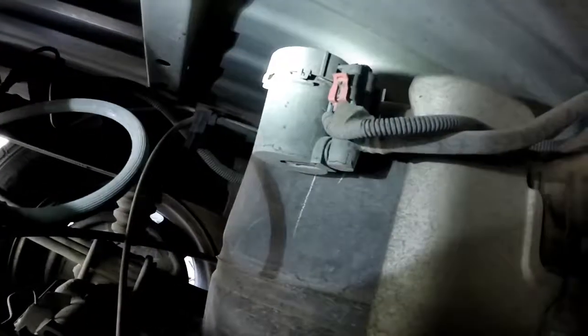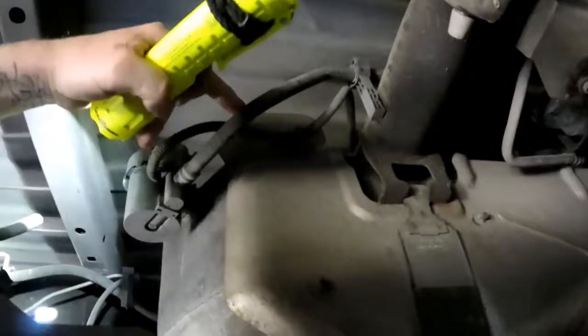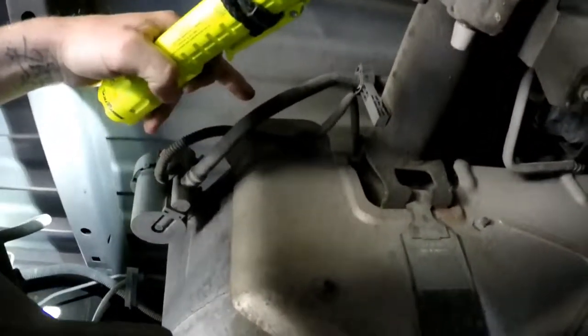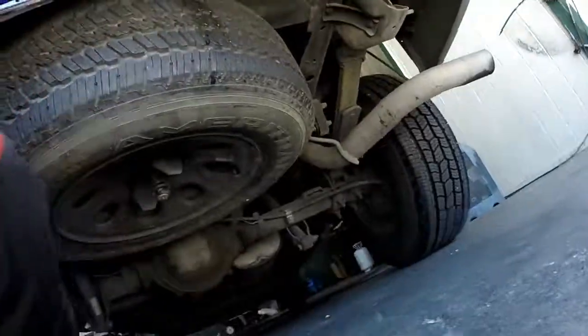This is the vent. What commonly happens is that this hose gets clogged and you get a vent code or evap code. Clean this out first — disconnect it from your canister to the evap vent, clean it out, put it back, and try it. You get road debris, spider webs, and stuff in there, which is super common for causing malfunctions.